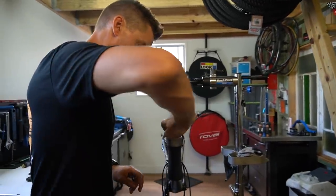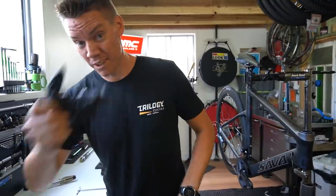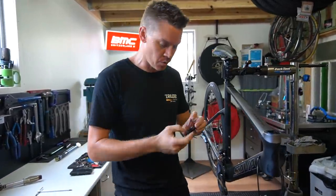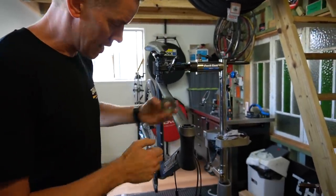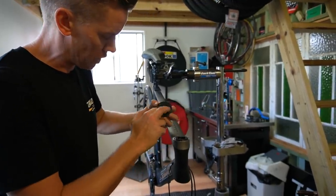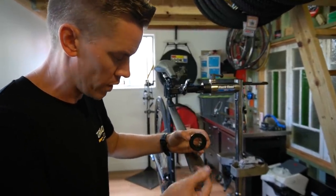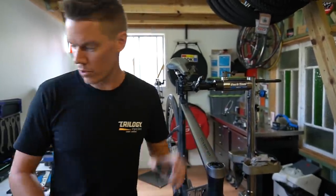You're going to use a non-lithium based grease — there are heaps of different greases for different applications. If it's all fresh and new and clean that's fine, but this aluminium on top will create issues. You'll get a lot of oxidization around there — that kind of white powder — so you'll want to make sure you grease that upper stem as well. Normally those are rubberized.